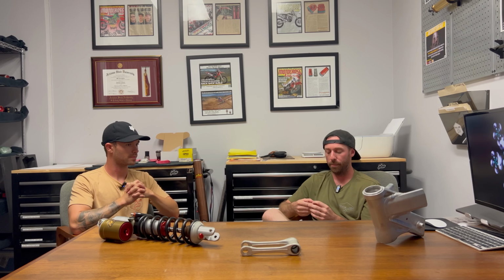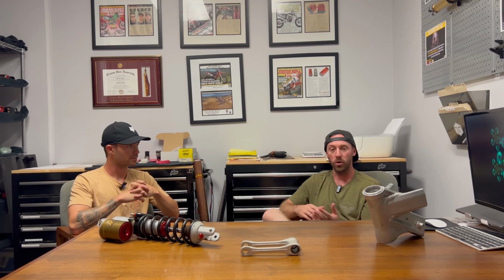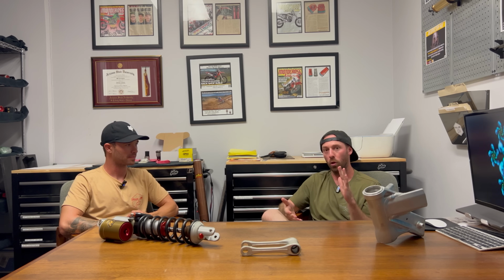The tire was a good example of the crossover effect. So what I commonly get is people will call and say, hey, I was riding today and I was having a hard time catching this inside rut. I want to slow down the rebound. I understand why some riders think that. They think, hey, I'm going to slow the rebound, the bike will ride a little bit lower, and you can do that. That will certainly help that scenario.